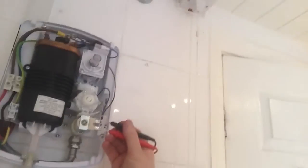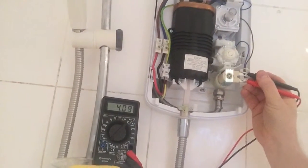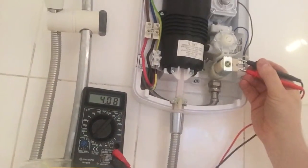If we come up to the new solenoid that's been installed, we'll see that we have 4.1 ohms, which is plenty. So we've just installed a good solenoid which cost maybe 10 to 15 pounds and about 10 minutes of time, as opposed to 80 to 100 pounds for a new shower and considerably more time. A little tip for everybody.